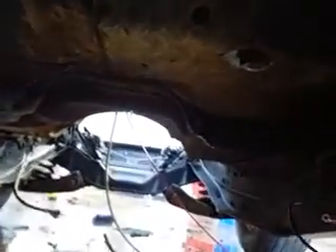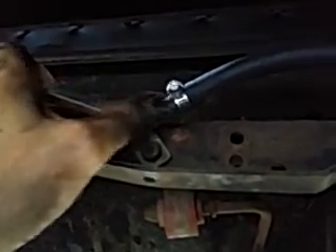Going under here, I've got a left side mount tank. The lines come out over the left side frame rail, come across this little crossmember, and originally ran down the right side frame rail and up into the bay. What I did was cut the feed line, flared the end, and put a little hose on there.